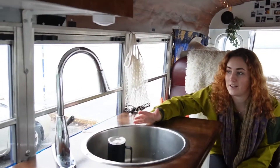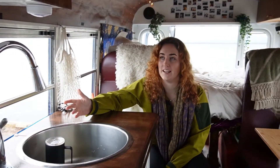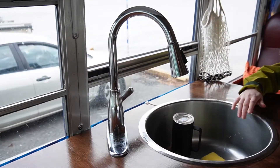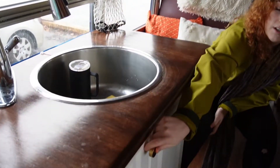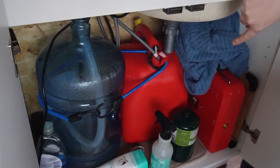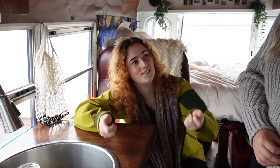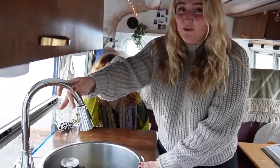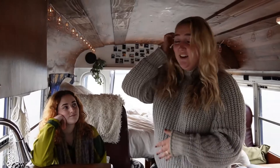One of the coolest things about this bus is our water system. We spent some time researching how to get running water since we're not hooked up to anything. Basically, we have an electric pump connected to a battery inside this bench, and whenever we need water we turn on the battery which activates the pump. We have two big 18-liter jugs as our supply and the waste goes into a canister right here. It also means the sink can turn around, extend, and you're able to shower outside — that's how we shower whenever we travel.